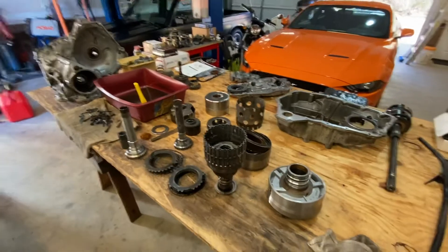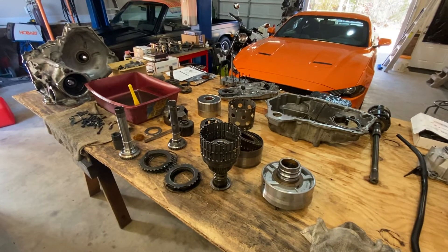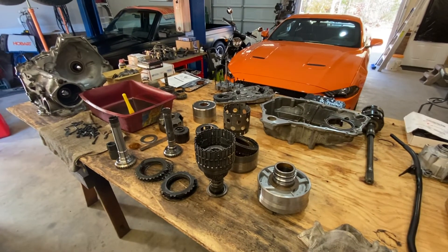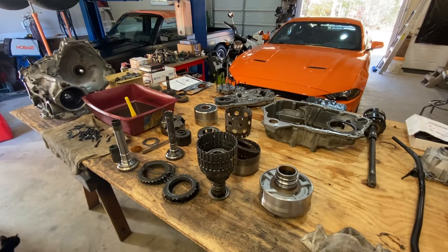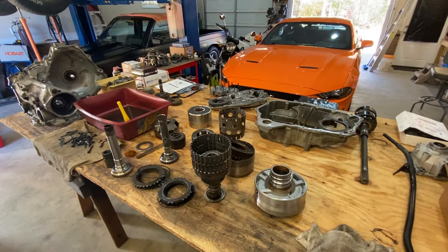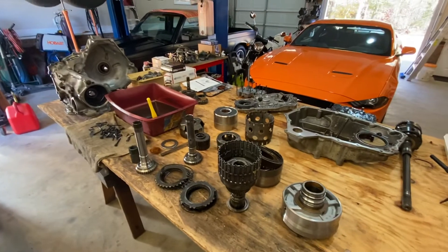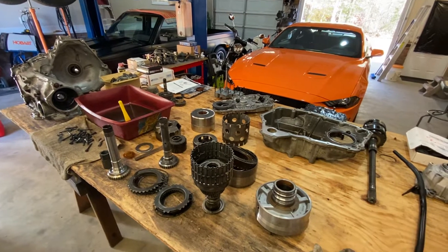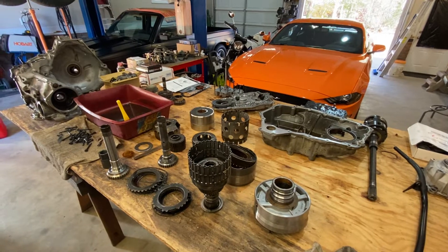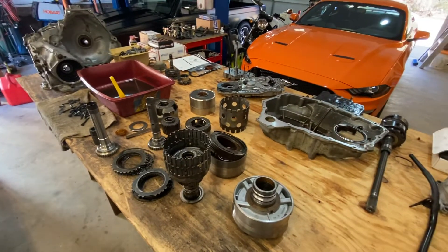This transmission actually was working okay when I bought the car to use for a drivetrain donor. It was a 2000 model Pontiac Grand Prix GTP. It had almost 300,000 miles on it and the transmission was not pulling. It would pull when you first started the car and after it ran for a minute it would quit pulling. I figured the filter was stopped up on it and sure enough that's what was wrong. I brought it home, dropped the pan, put a filter in it and some 5 quarts of new fluid and then the transmission worked okay. It was a little bit lazy on the shifts, and since it had nearly 300,000 miles on it, I wasn't going to put it in my project car without overhauling it. So I've got it all apart now.